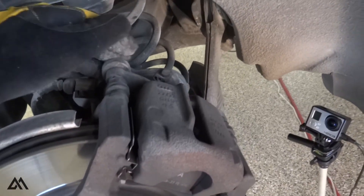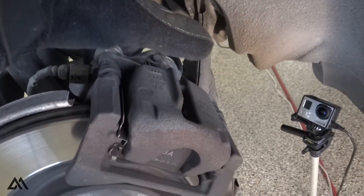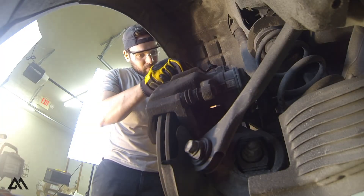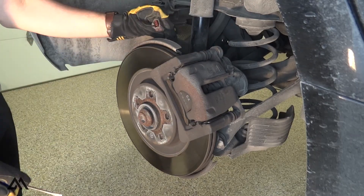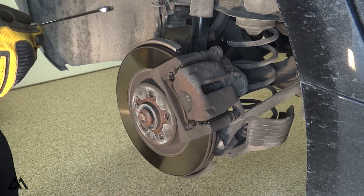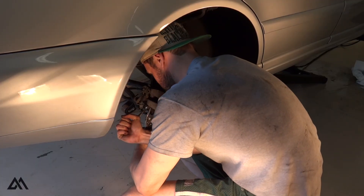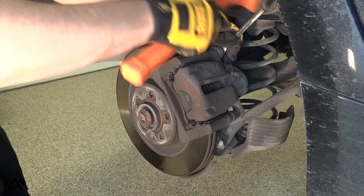Now that we have the electronic parking brake disengaged, we're going to remove the slide bolts — one right here, one down here. Once the slide bolts are out and the caliper is disconnected, we can stick a screwdriver in to compress the piston just enough to pull the caliper off. Then we'll take the rotor off, put the new rotor on, put the new pads in, and install the new hardware in the carrier. To remove the slide bolts you'll need a 13mm and a 15mm wrench — the 15mm holds the lock nut and the 13mm spins the slide bolt. The 15mm nut is very shallow, so you'll need a skinny 15mm, or in my case I used needle nose vice grips. These bolts can be tricky to break loose, but with patience and a rubber mallet you should be able to crack them loose and then remove the bolts.